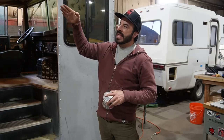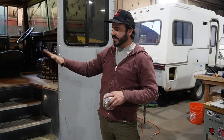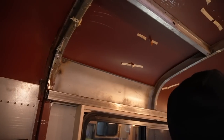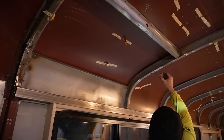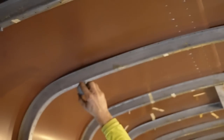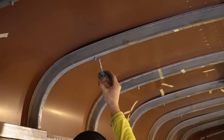We'll then go back up and get our rail height set — there's a slot in the top of those L feet that lets you set the height of the rail. Because I'm painting the whole roof white, I might take the rails off at that point until after the roof paint is done. Matt is brushing the anti-seize on the insides, and you can see the bolts come out right in the center of the hat channel — that's exactly what we want. Ben really nailed it.